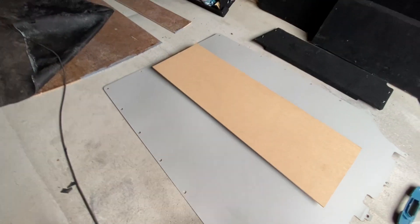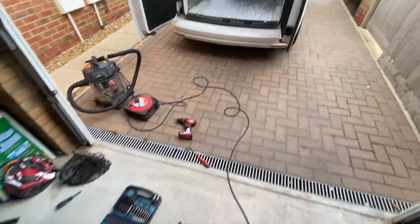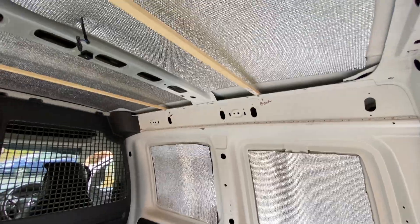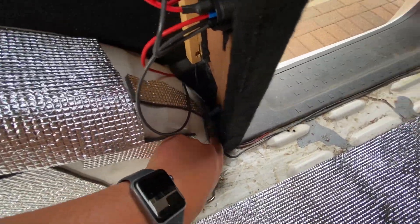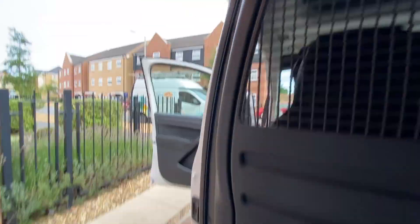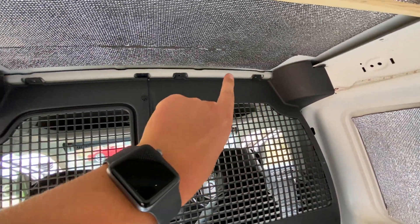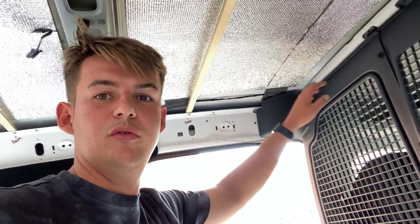And then there's going to be one, two, three LED strips along the sides so you can't see them. This is going to be wrapped — alcantara suede, something like that. Then around here I've taken out the shelf on the right, taken out the side, marked out the beam. And then we are going to be taking these wires from here — they run, that's the black and red in there — runs all the way up to the LED which is one there, you can see it, another one there. So we're going to be taking those and feeding them up around to the big center panel for the lights.